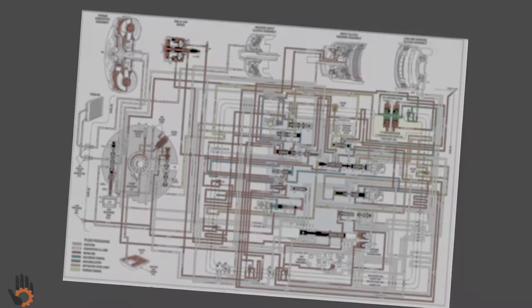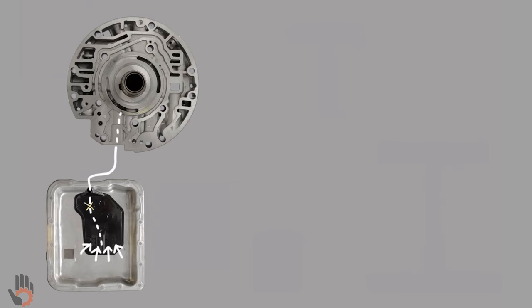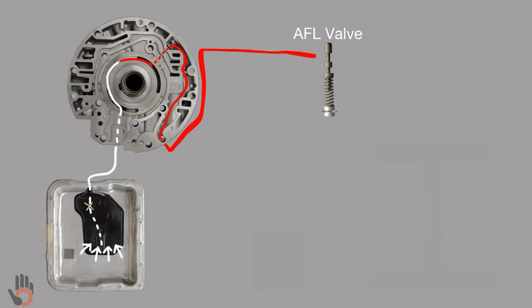Reading and understanding oil flow schematics can be quite difficult as they tend to be very complex — typically there's just way too much information going on all at once. So let's build a super simple oil schematic that focuses just on the oil circuit we're working on. Oil living in the oil pan is drawn through the oil filter and sucked into the pump. At this point, the oil changes from a low-pressure oil to a high-pressure oil known as line pressure. That oil makes its way through this passageway, around this corner, and over to the pressure regulator valve. The PR valve is responsible for setting line pressure. The oil then makes its way down to the bottom of the pump, exits the pump, and makes its way over to the AFL valve.